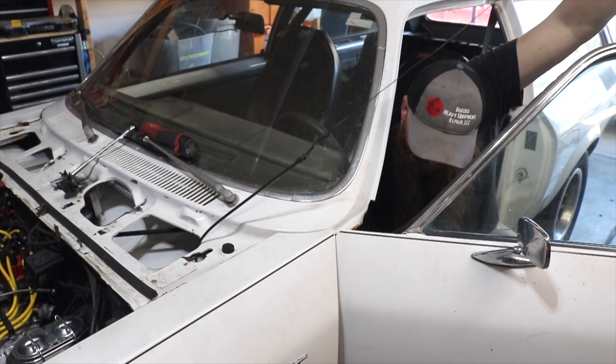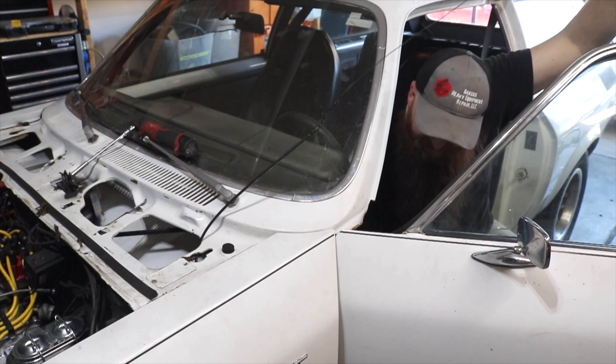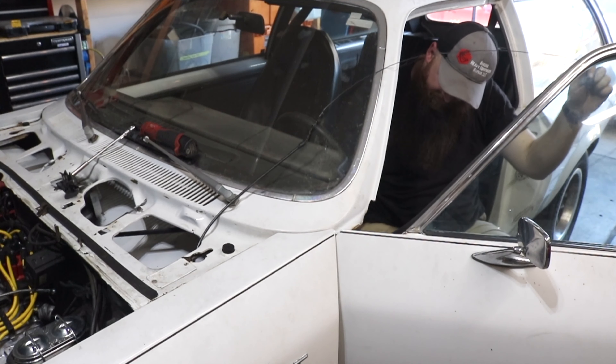I found that if your arms are long enough, you can feed the cable in from the bottom with one hand and pull the bailing wire up to the top with the other. It's not easy — it'd be way easier with two people. We'll start by installing everything down below. First, separate your jam nuts a little bit, just enough that you can slide it into the hood latch bracket. After tightening the jam nuts, slide your ball end into the hood release arm.